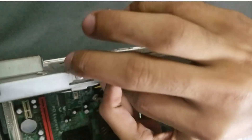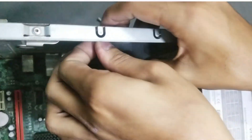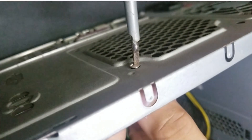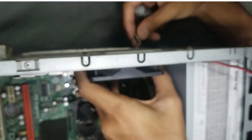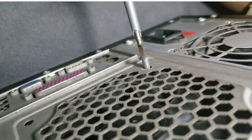While placing a case fan, always put the face part inside, as this part will suck out the heated air from the unit. Identify the fan's front and rear — the rear part is covered with the casing and the front part is open. Each case fan has four screw holes on the four edges. Place the fan to your selected spot and use a manual screwdriver to join the screws.